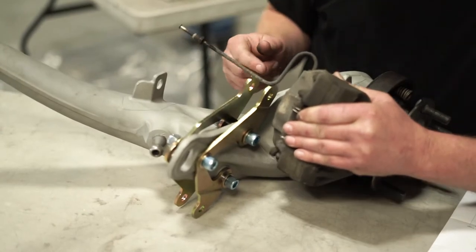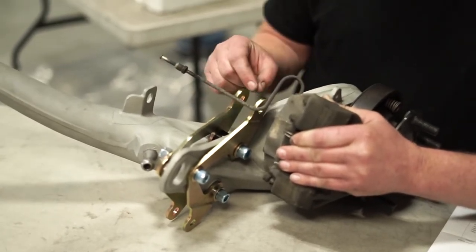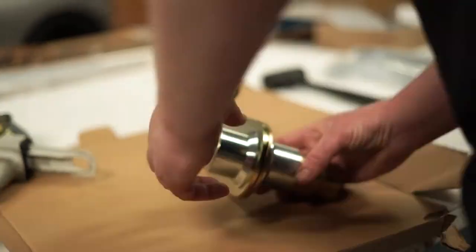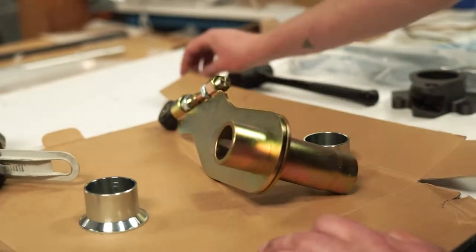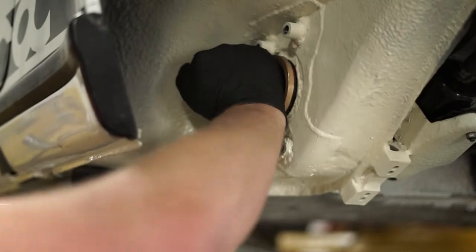Note that when installing ASP spring plates the rear brake lines will require rerouting behind the lower and upper plate. For this application we're using the poly bronze spring plate bearings and quick change spline hubs, which are not included. Instead you could use a set of factory spline hubs equipped on 77 to 89 911s and any bushing designed for factory spring plates.